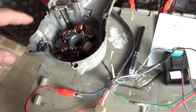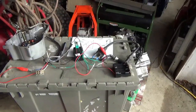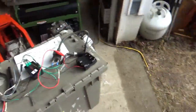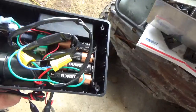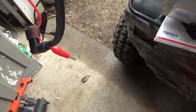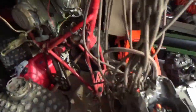Instead of using separate batteries, you can use the 12 volts from your quad if it has a battery — this setup is really handy for troubleshooting. What I did is put it all in one box, which makes it so easy. I just clamp the red wire to the pulse generator blue and yellow, one wire green to ground, and the other wire clamped to the case.